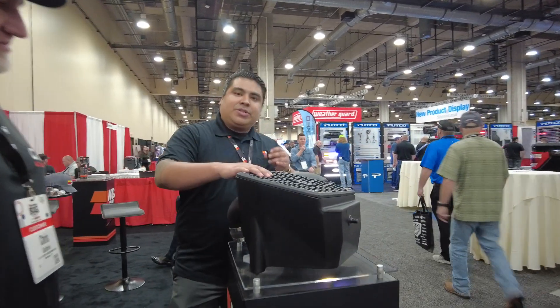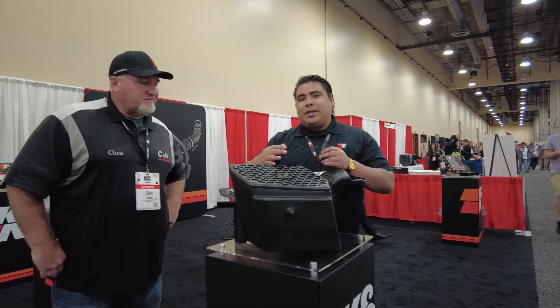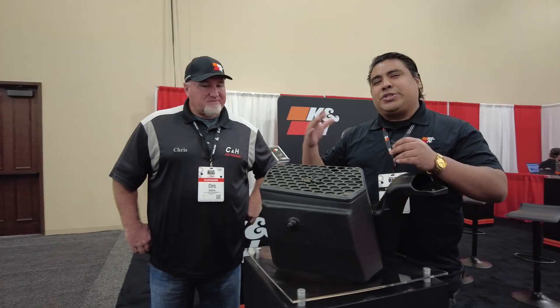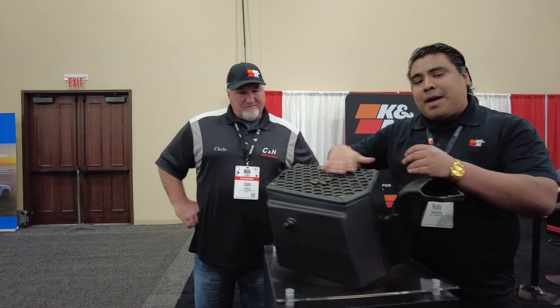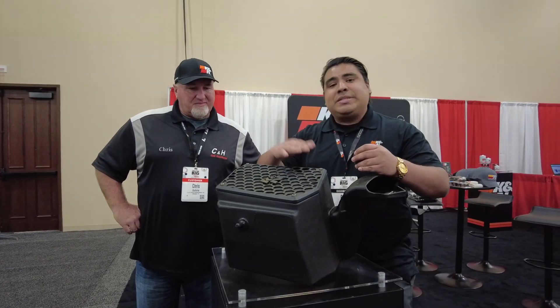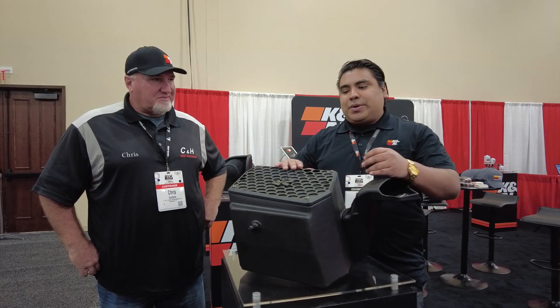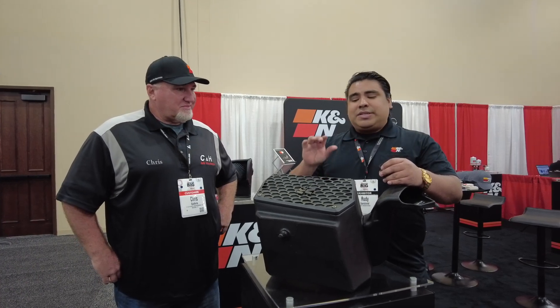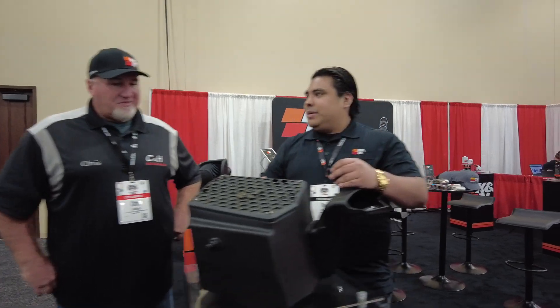We also have complete closed-in air box kits. These have pre-filters on top to extend your service intervals. A standard paper element filter needs service every 10,000–12,000 miles, but our conical oversized filter has a lot more surface area for holding dirt — great capacity and great efficiency. With the pre-filter added, your service intervals can go anywhere from 75,000 to 100,000 miles. These are meant to last the long run. Every single one of our kits comes with a dyno chart and easy-to-follow instructions showing the horsepower and torque gains over the OE part.